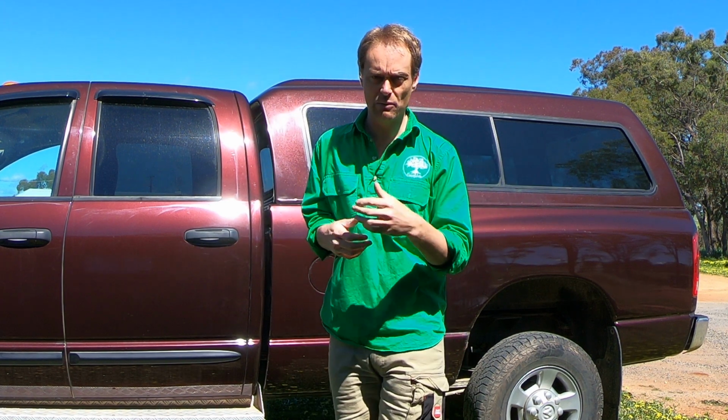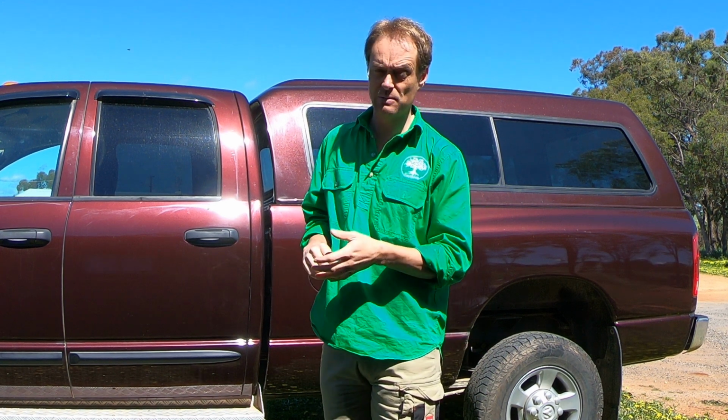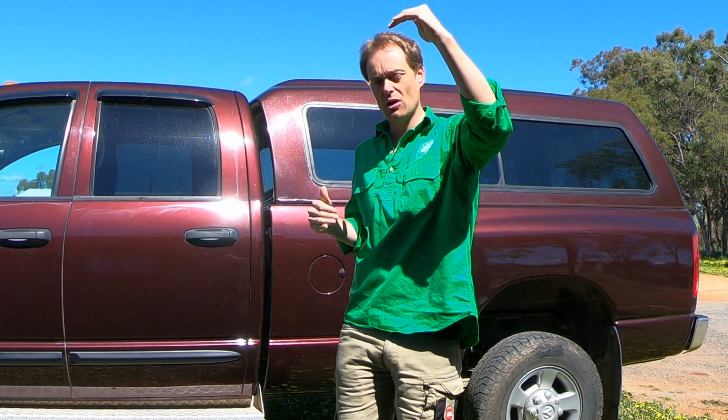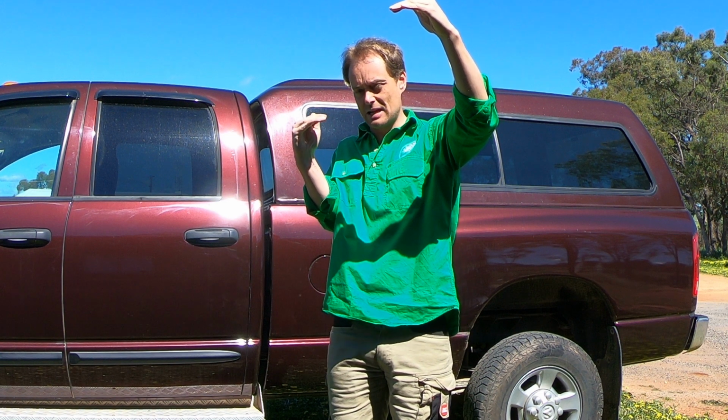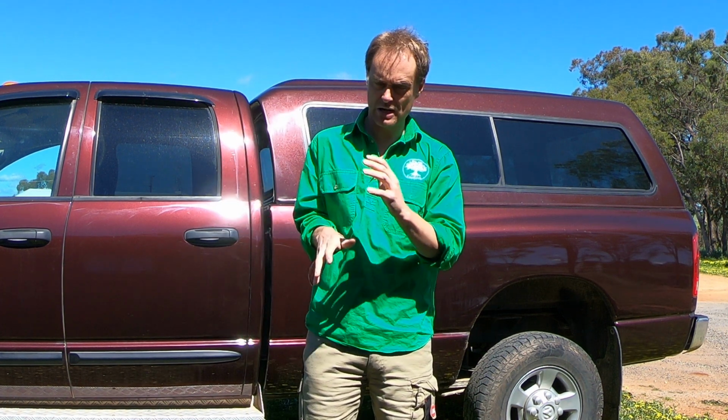Now, you might have a factory gauge. Some trucks do have a transmission temperature factory gauge. Not many, but some do. Or you can get access to the data being relayed from your transmission temperature sensor. You can watch that, and then if you have a gauge in the hotline, you can compare the two. And when the hotline's getting hotter and the transmission temperature hasn't started to move yet, you know it's going to start bumping upwards. Between the two, you should get a comprehensive view of what your transmission is doing.